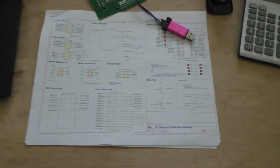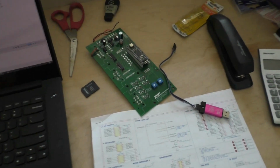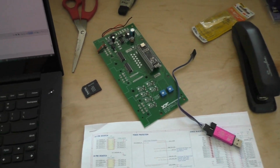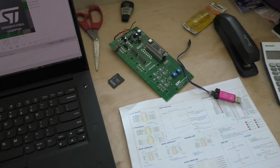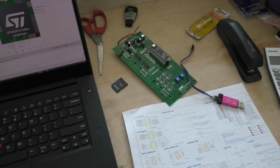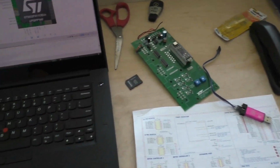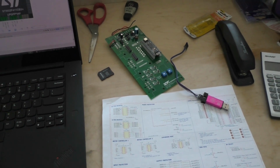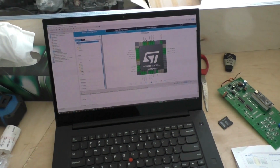One of the biggest things is I'd like to have CAN implemented on these boards, so we could just install multiple of these boards in the car and communicate across them for different features. For example, the rear wing, a shifter module, and maybe some inputs from accelerometers can all communicate to each other, hopefully save to something like a data logger, and this should improve the data capabilities and what we can get out of this ASL car.